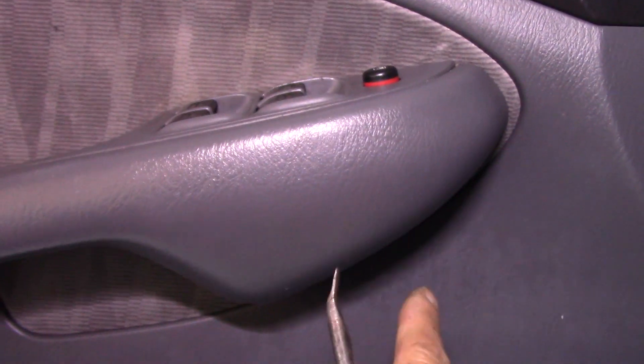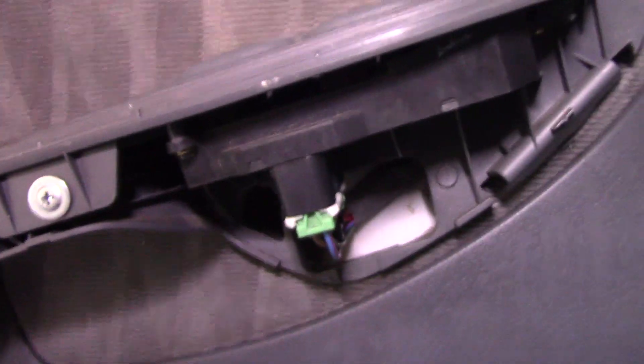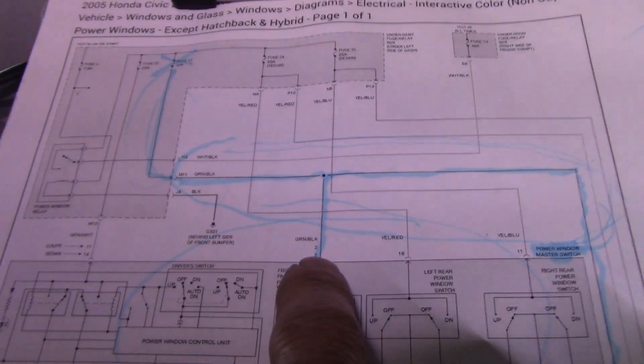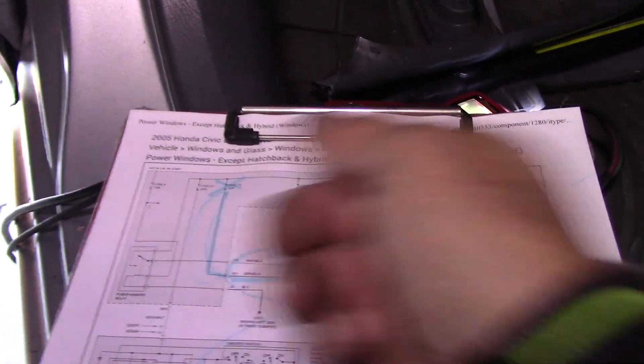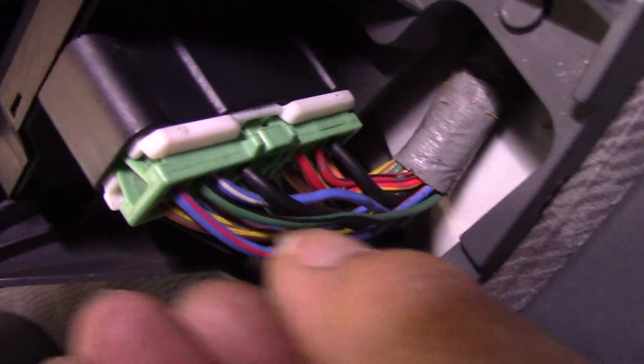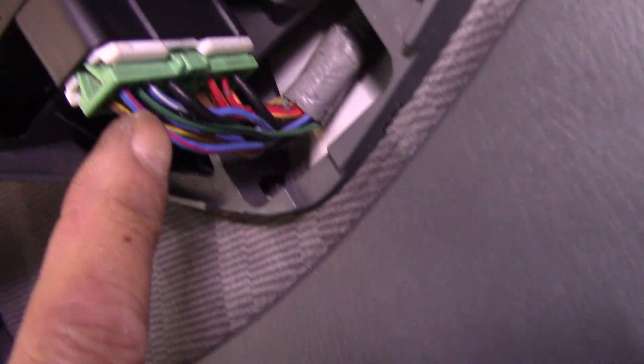This is a 2005 Civic. If your vehicle has this problem, you want to access the master switch. As you can see, using a little pry tool on the back here, we have the hole here, I can pop it out right here, guys. Pull that out, and as you can see the connector right here. I want to check, following the wiring diagram again. You see the green and black wire, pin number two. If we see ground right here, that means we got a short on the wire, and the short to ground blows the fuse. From the switch connector here, pin number two, the wire color green and black. I check and see - we got ground right there on the tool, it's telling me ground. So we got ground from here, that's why it blew the fuse.